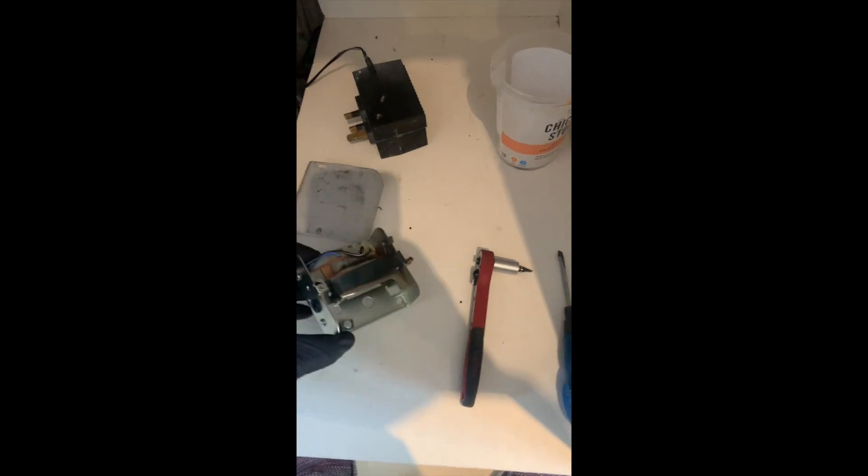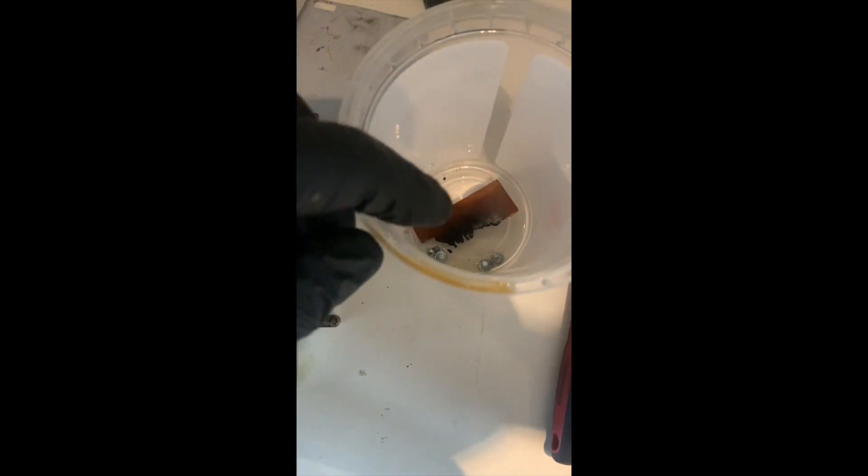It's hard to imagine wax forming inside this, but it definitely was wax. So whenever you go back in, that should be nice and springy — when I came to it, it wasn't springy, it was solid and stiff. I'm going to make another little video just about this part, which is the electrical control box or electrical thermostat that sits on top of that wee pin. This bolt's on with just three screws, but when I took it off I couldn't help but notice there was a burnt piece of paper or something on it. In fact, it's a bi-metallic strip.